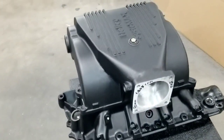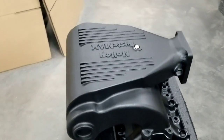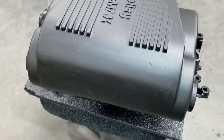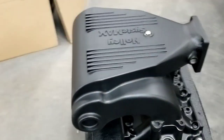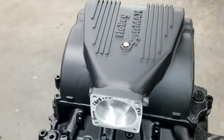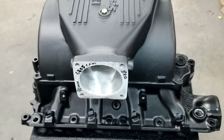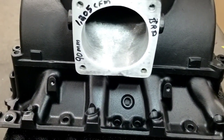What this BRD Stage 3 Systemax Intake Manifold is — it has been completely cut open. We shortened the runners and completely ported the upper and lower. The upper is inside; completely did the lower, Stage 3 Max port. And we also created a 90mm throttle body tunnel.